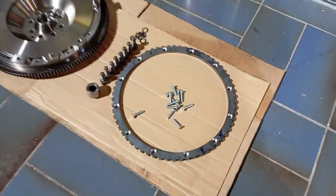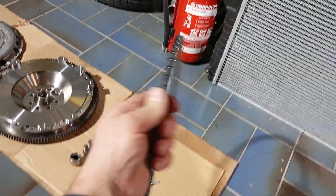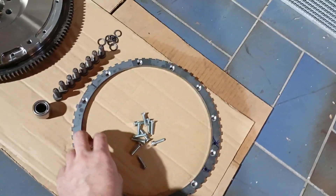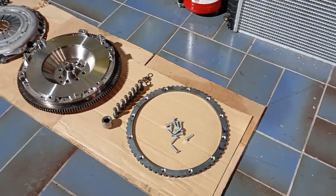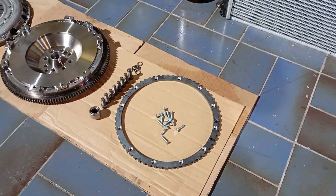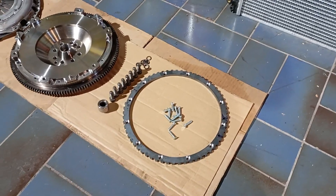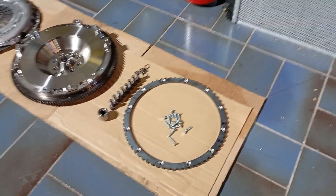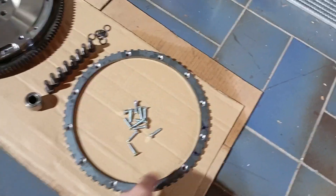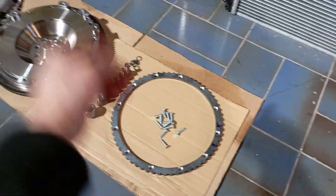Here I have the 60-1 type which is used on the M111 from stock, for example. I also offer them with the five-tooth design for the old OM605, also the 60-2 design, and also the design for the early M104s and early M111s which only have two big segments. Also with a magnet — on the M104s it was three segments with a magnet.